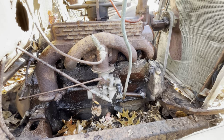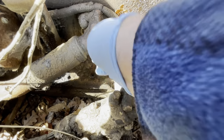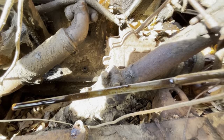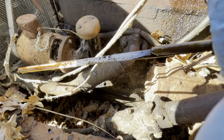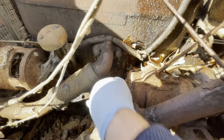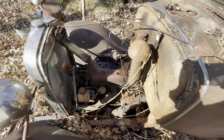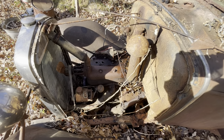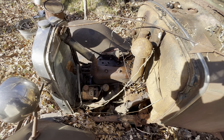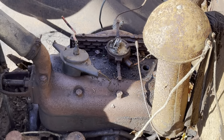I'm not seeing any place where our mixture is coming out, so my only assumption is the head gasket is bad and it's going into the water passages, or it's drained straight down into the crankcase already. I pulled the dipstick but I'm not seeing any indication of the fluid we added. I'll admit I know absolutely nothing about a Ford Model A — my knowledge is based on what I found on YouTube and limited experience with a couple of Fords and tractors. I'm going to stop for now, do a little investigation, and be back soon.